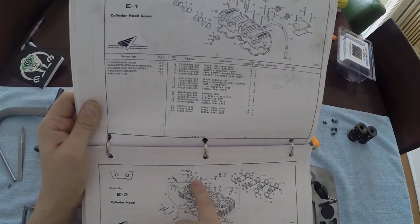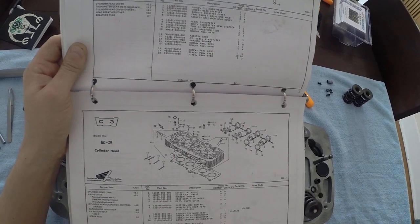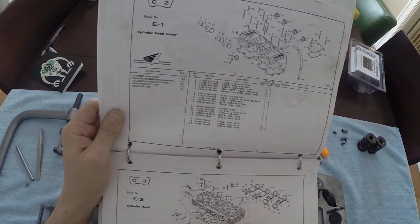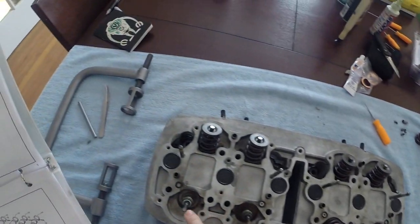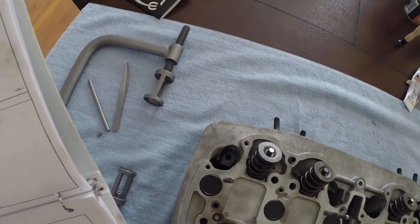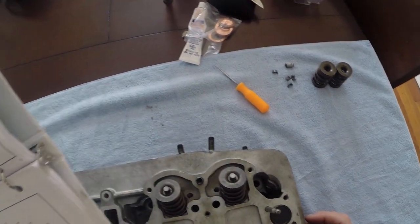We installed the O-rings. There's another 15 O-ring. And sometimes you gotta check because it only shows 3 on the drawing here, but you go down to number 15 and it shows 4. So this is the more important number here, not what's going on in the drawing. The drawing is just a representation. It doesn't show all the parts. So that's got that O-ring, and it's in that general area over here. I mean, that's for a cylinder stud for sure. And this is for a dowel, and none of the other dowels have O-rings.